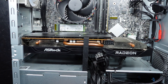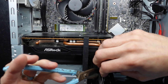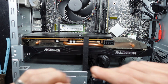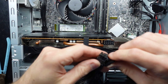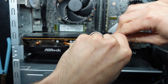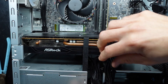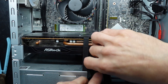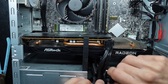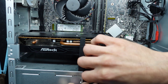Next I need to plug in the auxiliary 6-pin or 8-pin connector. As I was saying, if you were to upgrade to something more powerful like a 6700 XT or a high-end 3060, you would have to change the power supply as it won't have enough wattage. The 6600 XT is about the biggest upgrade this machine can do without changing the 500W power supply, as it falls within its requirements. That would be my go-to recommendation to upgrade the Acer Nitro.